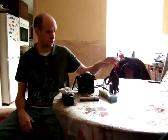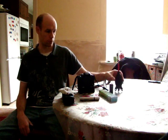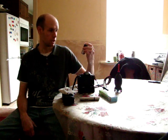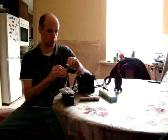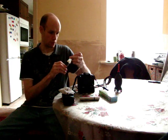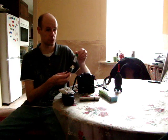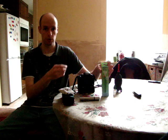I've got some cleaning equipment laid out here. I've got the Giotto's rocket blower, which I use for cleaning the external parts of the camera and lenses — I've already uploaded a lens cleaning video. I've got my sensor cleaning solution, which is Visible Dust sensor cleaning solution — the green solution. I also have Visible Dust cleaning swabs, which is what you put the solution on. You bring the pad across the sensor — well, not the sensor itself, it's the filter that you actually clean.